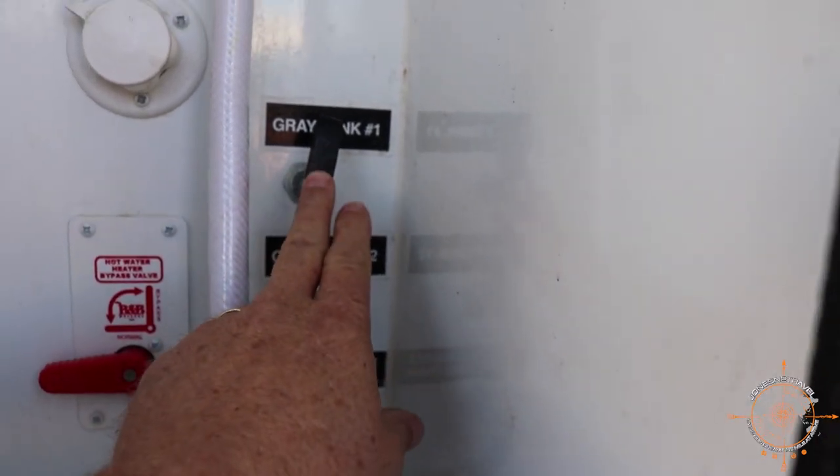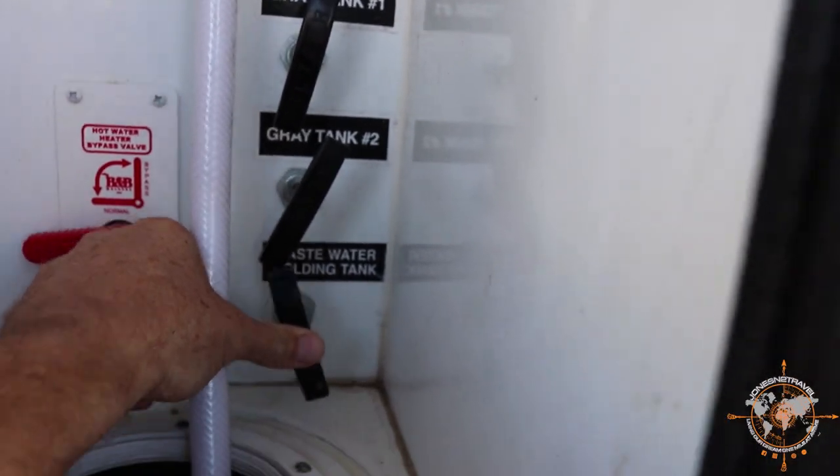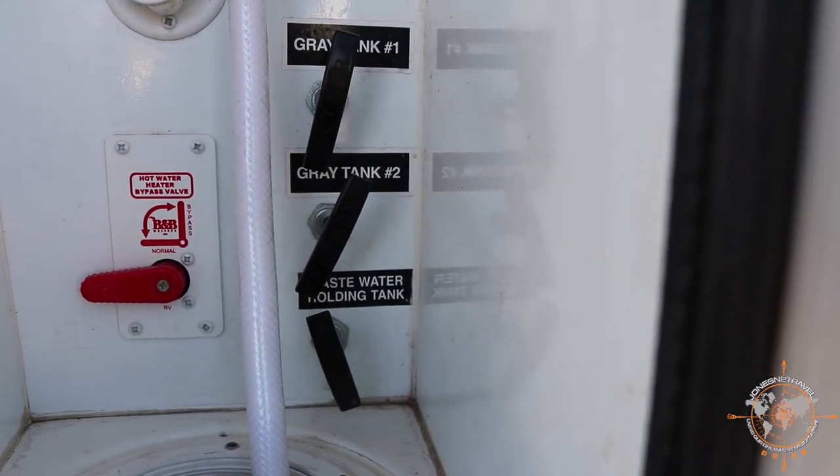If I'm going to replace that one I'll go ahead and replace the other two as well. It's a lot to get into, but it's not too bad — you just have to take more of that belly pan down. My valve doesn't say Blade X on it, so I went on Amazon and found the seal shown for my style of valve, picked it up and it worked. They make them for the inch-and-a-half, two-inch, and three-inch waste line. I'll put the links below for the seals, the gloves, and that magic lube — it works really well. You can see now gray tank one is closed, gray tank two is closed, and black is closed. Just some new seals — pretty easy stuff.